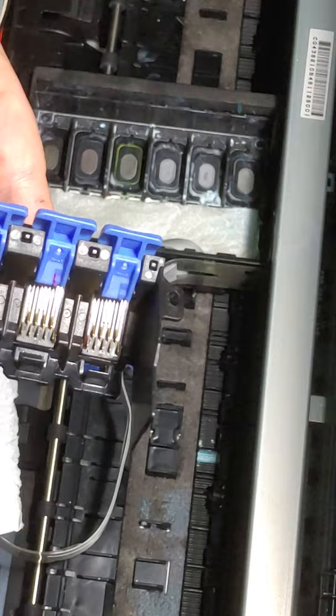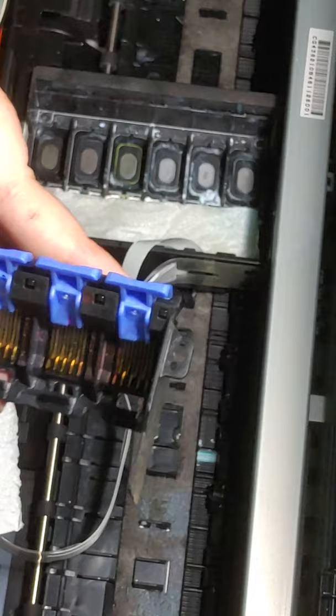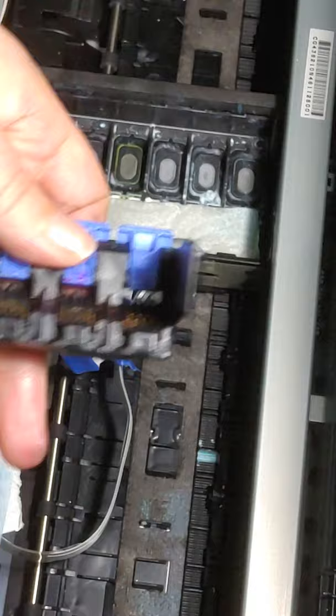So somebody asked, why do you not want to get cleaning solution on here even though you're not using it? Corrosion. So we don't want to do anything to our printers that is going to cause the dreaded fatal errors. And even though we have chipless firmware in there, we don't always know what's going to cause it. And so the name of the game is just do everything you can to prevent it.